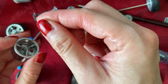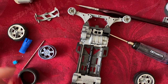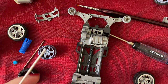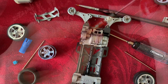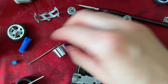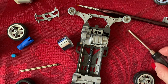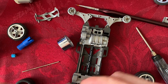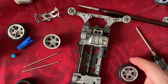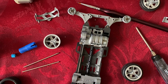I'm going to remove these axles and test them with the shaft tester because I want to make sure they're straight. I've discovered that more than half of the shafts out of a box stock kit end up not being straight. These ones are pretty good — very nice. We bought from a good dealer, AAA Hobbies, and it has quality stuff. If you buy from someone online you never know what you're going to get. It's always best to get fresh stock from your local hobby store.